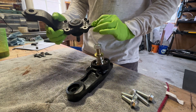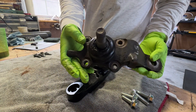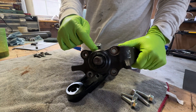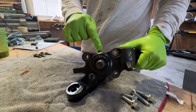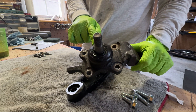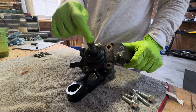The actual ball joint on the stock one is a ball and socket — this post goes into a ball that is one piece inside the ball joint. It necks down at the base where it connects to the ball, and that's usually the failure point. If the bolt itself breaks off, it'll shear right there.